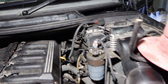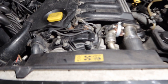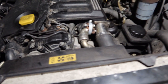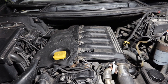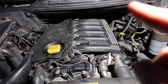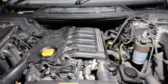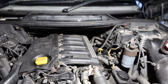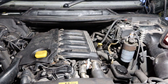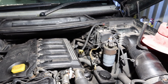As with any other electrical work, I'm going to start by disconnecting the battery before we start tucking into this — it's just safer because we're going to have the main lead hanging off the back of the alternator. Before I do that, there is one other step: always remember, if you're working on a car with an electronic tailgate, make sure you pop it open first, especially if all your tools and spare parts are in there. So I'm going to pop that open and then disconnect the battery.